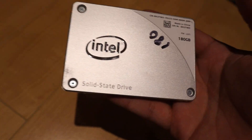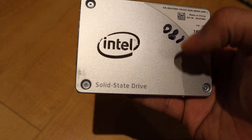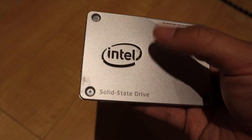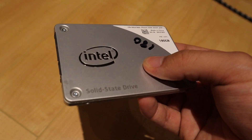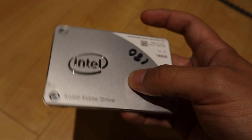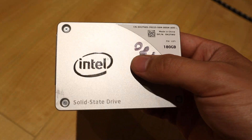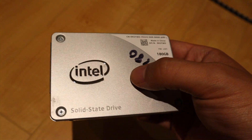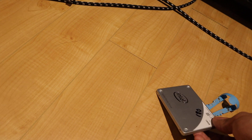This right here is an SSD. Old laptops used to use disk drives for storing all the data - a 2.5-inch disk that spins at 5,000 RPM. Those can store a lot of data but they're slow because they need to start spinning and then read the data. SSDs are used in everything now - it's a silicon microchip inside that stores data and can access it very very quickly because there are no moving parts. If you install one of these and install your operating system to it, your laptop will start up noticeably faster.